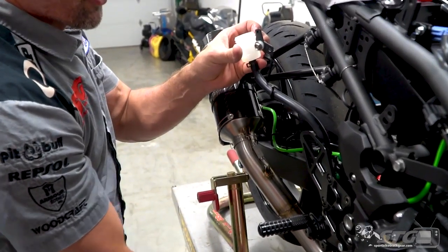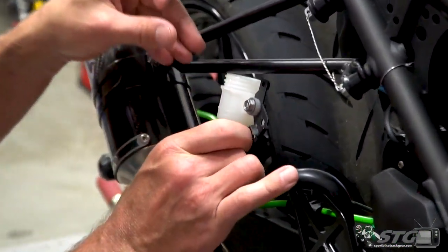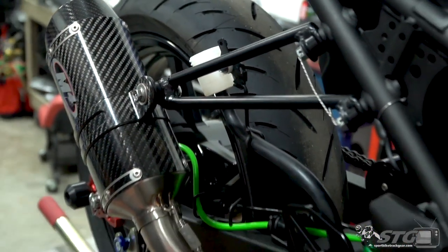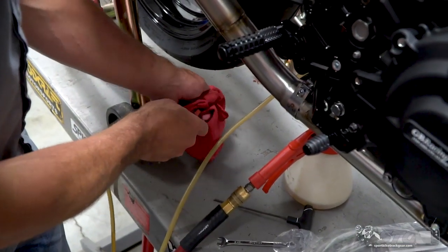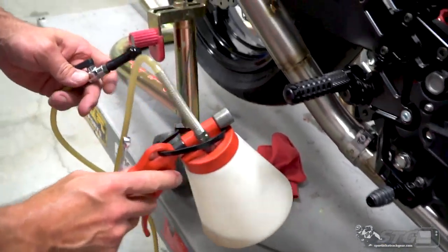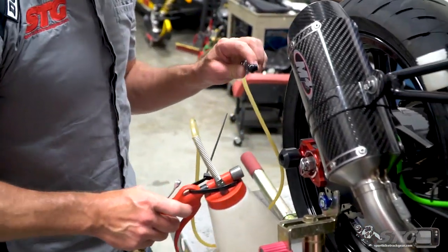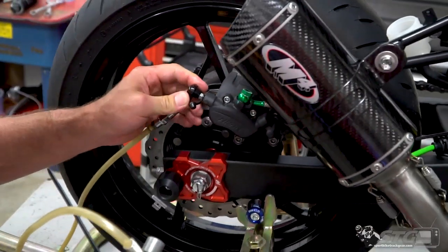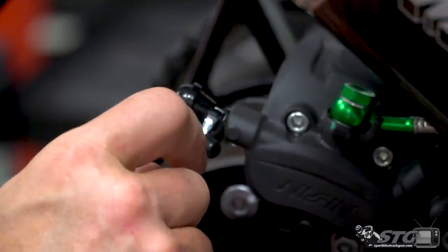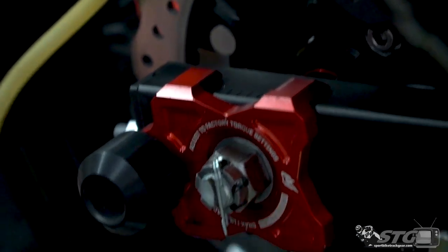It's really important to remember: brake fluid is hard on paint. You want to do the best you can to clean any surfaces that come in contact with brake fluid almost immediately. What can you use to clean it? A lot of different things — soap, mild soap with some water, Windex. A lot of different things will work well for that.